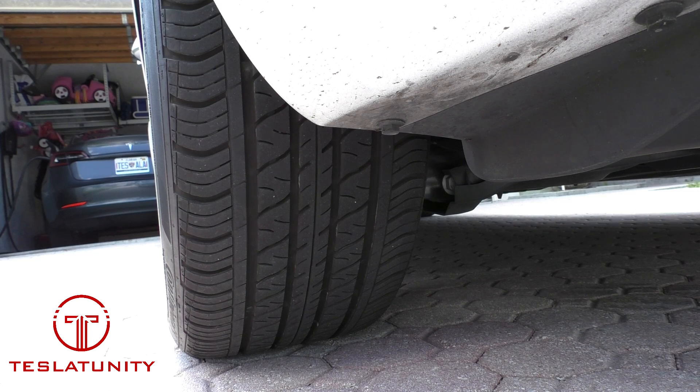In the case of my wife's car, this is actually post-tire rotation, so these tires were up front just about 15 minutes ago. They wouldn't let me record it, unfortunately, so I'll walk you through what that looked like. The rear tires were slightly more worn than the front tires — it's what you'd expect, it's a rear-biased car. The Tesla Model 3, really all Teslas and all electric cars, have a lot of torque, so you go through these tires maybe faster than a regular ICE car would. It's really important to rotate the tires for maximum life.